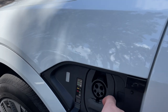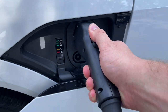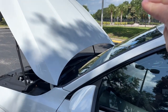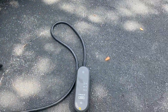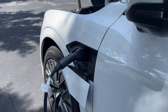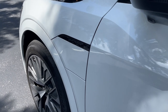That's a 30% improvement in range, and they've also improved charging speed. It goes from 150 kilowatt peak to now 170 kilowatts, getting you a 10 to 80% charge in just 31 minutes. At home on an AC charger, you'll get 9.6 kilowatts, which is pretty average, and with the bigger battery that'll take about 13 hours to charge. But for $1,850 extra, you can get a second charge port on the passenger side. Using the included charger, that can get up to 19.2 kilowatts, giving you a full charge in just six and a half hours — though not everyone will have 19.2 kilowatt output at home, especially in an older house. It's also worth noting that because the Q8 e-tron is a Volkswagen Group product, you get two years of free charging at Electrify America.